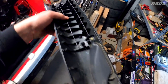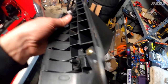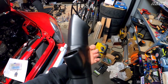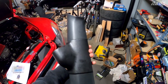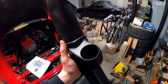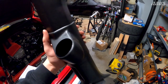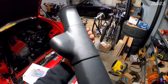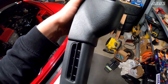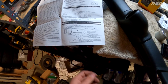The single gauge pod is mounted up and worked pretty well. I drilled a hole just above the rib to feed the wires through, just large enough for the larger connector. Overall it doesn't look too bad — I don't love it, but it might grow on me. I know Science of Speed sells a full-molded single-piece pillar, but reviews say it's off-color, cheap, and doesn't fit well. This AutoMeter pod matches the color nearly perfectly and is molded to fit just above the OEM window defroster mount.